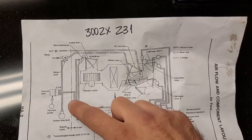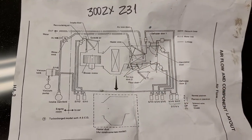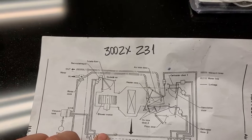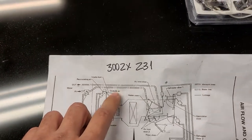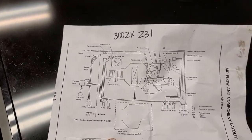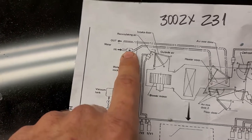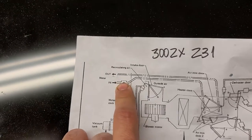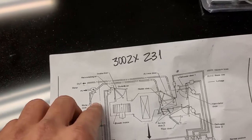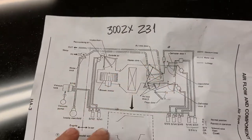What happens is when you got a vacuum leak or something bad with the vacuum system, they're not going to work right. A common issue when the vacuum tank is bad is that you've got the AC on and for some reason you only have air coming out the outside — the air that goes into your windshield — so you get only air and hot air coming through that band. When this guy is bad it's not creating vacuum for this water valve right here. What this water valve does is it opens and lets coolant go inside the heater core inside the car so you can have heated air. When this guy is bad, you're going to have that issue and also you're not going to have vacuum to close certain bands inside the system.